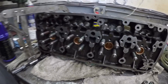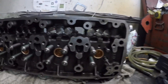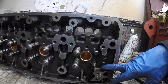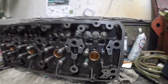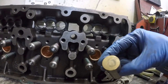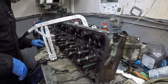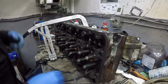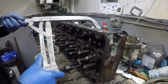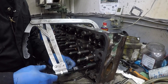Here's the head with the valves in it. You don't see too many Detroits being put back together anymore. To put the exhaust seals on, or valve seals, I used a bronze punch — something soft. You can see the marks on it where I've driven in the seals. There's not too many videos on YouTube showing Detroit valve installs, but I thought I'd do a quick one here.